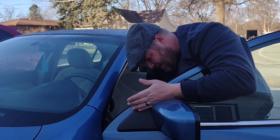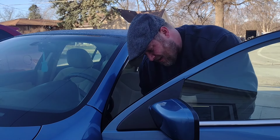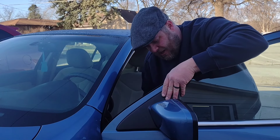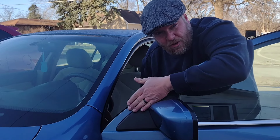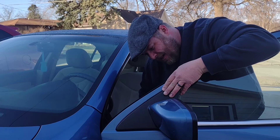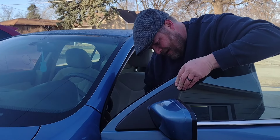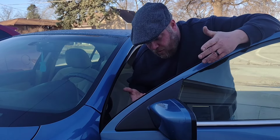Line everything up with my bolt holes in place, get a couple nuts started so I don't have to worry about it falling off and breaking this one too. A tip when installing these: it is plastic - your nuts and your studs are metal but those studs are just fed into a plastic shell, so you don't want to go crazy tightening these things. You'll see it start divoting and you can even possibly crack the plastic, so really take it easy, don't over-tighten. Just get it good and tight to where you've got that seal sitting flush all the way around.